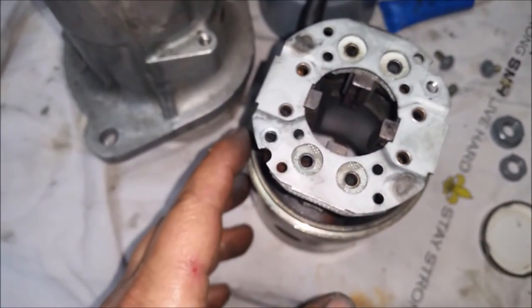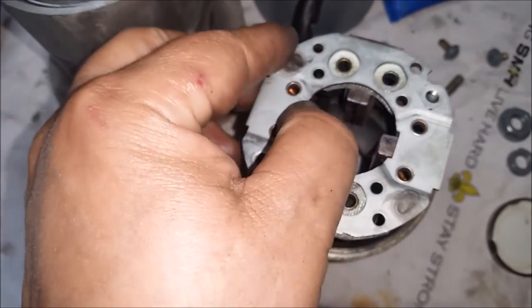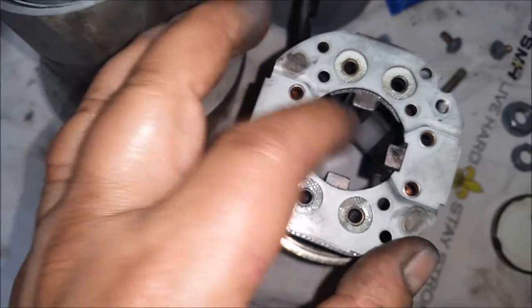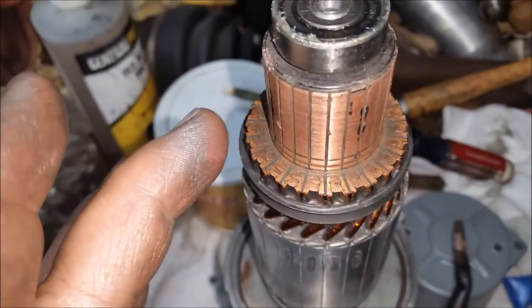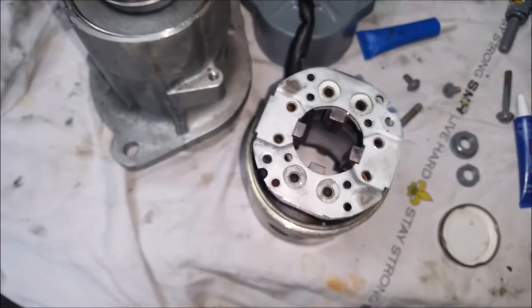The next thing you're going to do is install this. You install it one side and squish these in, then with two fingers and two hands you push these aside. Kind of wiggle it a little bit and be gentle with it because these are brittle and they'll break or chip. Make sure this is clean — I usually use a paper towel with a little bit of brake cleaner and wipe all the way around.